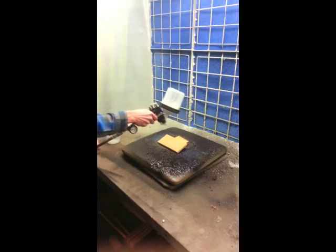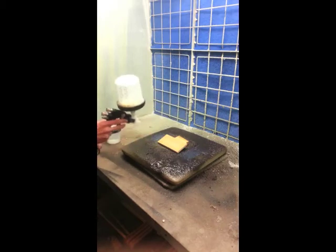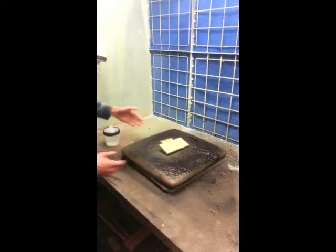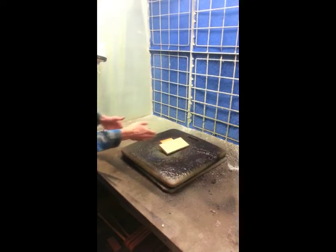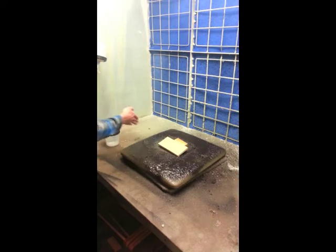Start off to the side, sweeping back and forth until the part is evenly covered. I'm going to clear coat along the long axis this way. If I were to spray the other direction, the back would be further away and would cause particles in that area. So spraying along the long axis helps.